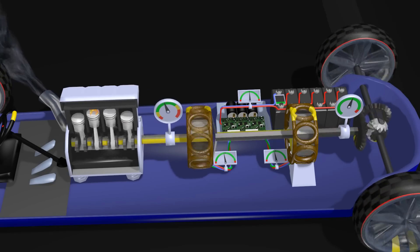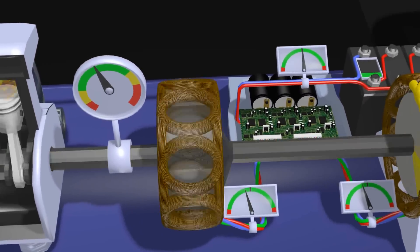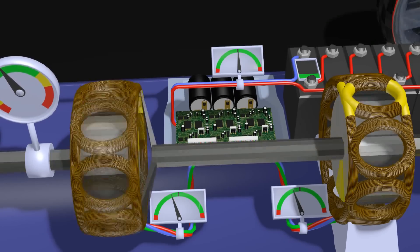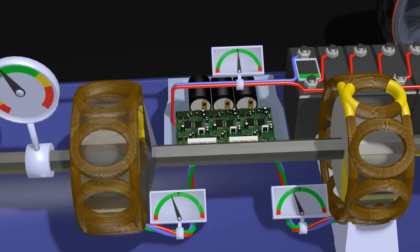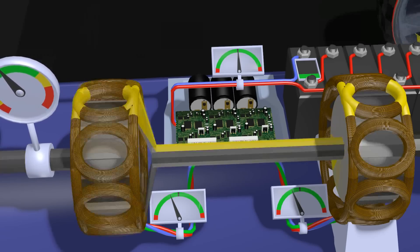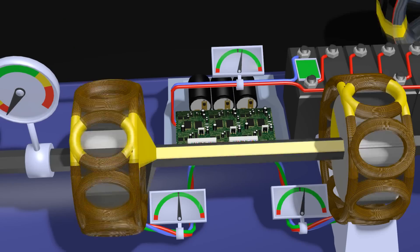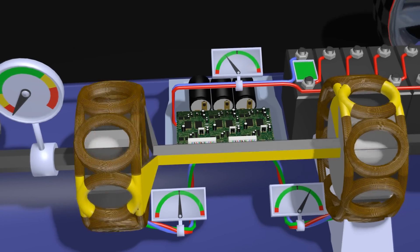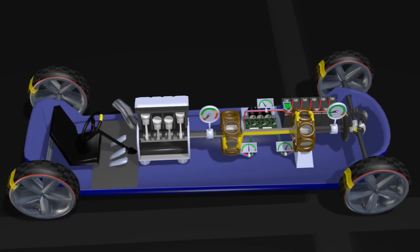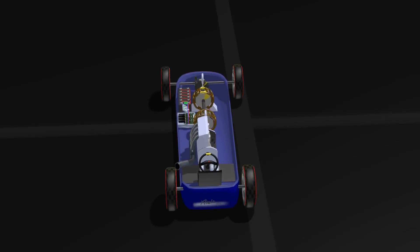When you're up to speed, cruising along, the battery will mostly do nothing at all. Remember, when you convert energy, you lose energy. Storing energy in a battery only makes sense in those special cases: start-stop driving or idling. And we can use the energy as a brake, and use that energy to fill the battery. And last, you can drive on the battery — not fast, not far. It's really mostly a party trick, but it's a great selling point.